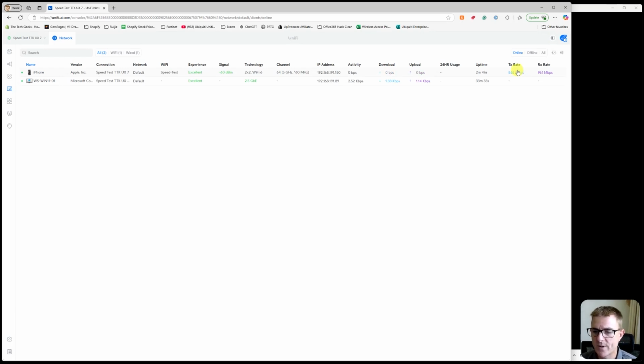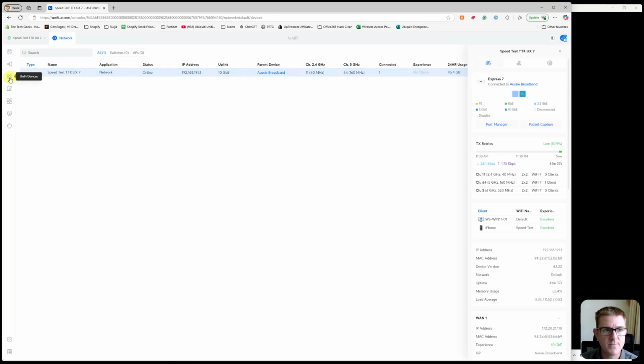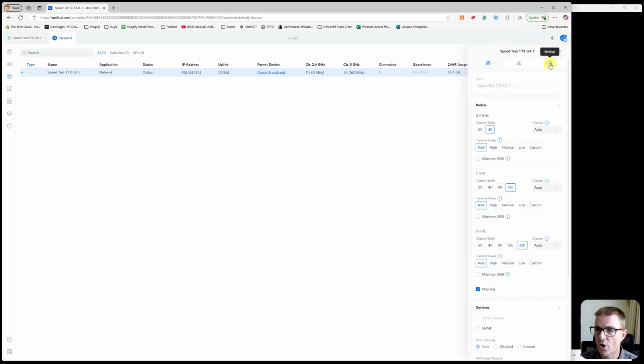So what I can maybe do again, I could easily disconnect and try again, but it's about the balance of getting those settings right for your performance. So you can see you can get up to about 1.3 gigabits a second if you manipulate the channels in the way that you want. So just a reminder, you do that, you go into the devices, find your device, go onto the cog, and then manipulate these to what you want.